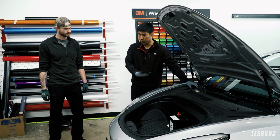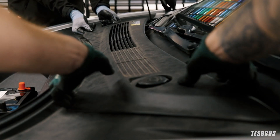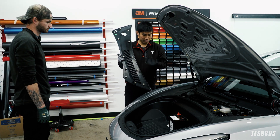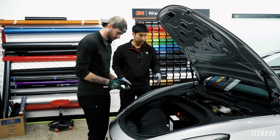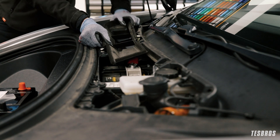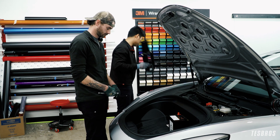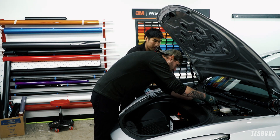Go ahead and remove the top cover on both sides. I like doing quick pulls — there are about eleven clips over here, so just keep pulling up. Put it in a safe place. Then remove the air vent as well — same thing, just pull it up. There are only four clips. Make sure you remove that because it blocks access to the positive terminal of the battery.